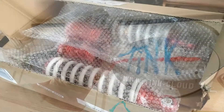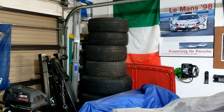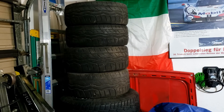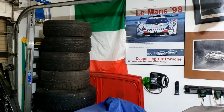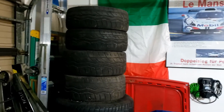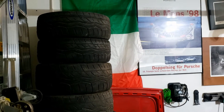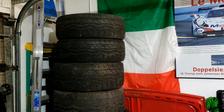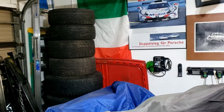We're also building a tire collection. In addition to the spare FJ set on the bottom, we now have the race car tires - at least one set of them - ready for the Hankooks, which are sponsors of the Lucky Dog Racing Series. We'll be getting those re-shod. They're wider at the front but should just fit the arches of the Porsche. They use the same tread wear - for Lemons the rules are the tires have to be street legal and 200 tread wear rating, which the Hankooks are, so they'll be good for Lemons too.